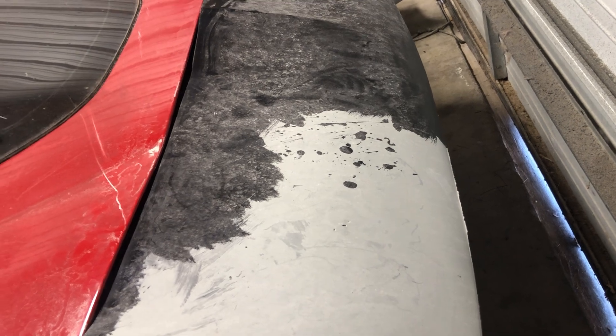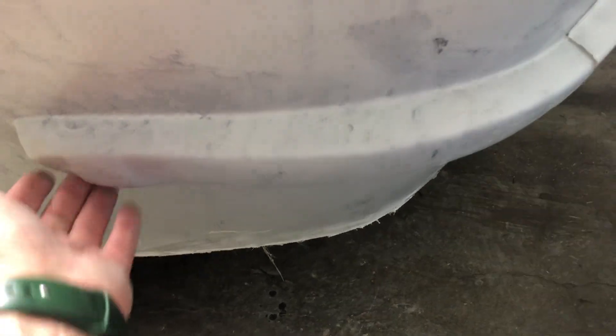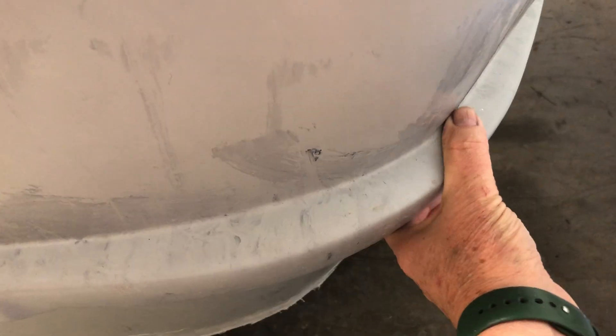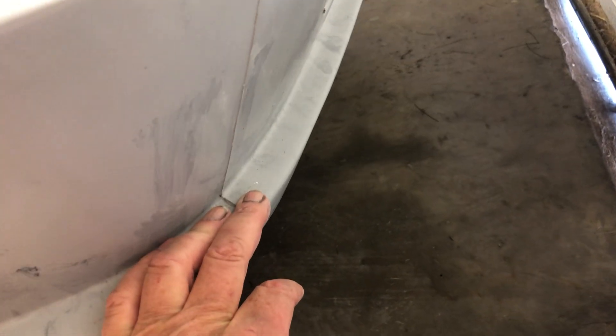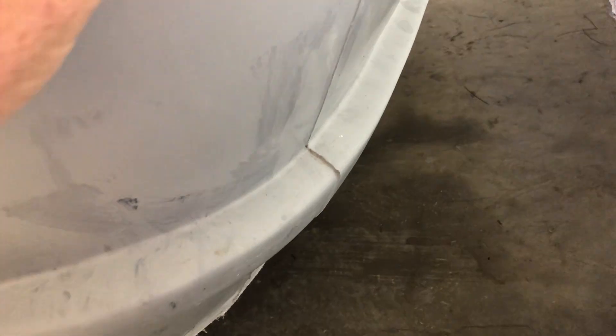One of the advantages of redoing the back end is this one is for a C2 Corvette replica to do the grand sport. The grand sport does not have a back bumper, so if we want this to be more like a grand sport then this back bumper has to go, which would mean cutting it off and splicing in a flat piece. Or if we make it from scratch, it would be relatively easy inside the mold to just use some aluminum tape across it so that there is no indentation from the bumper extrusion.